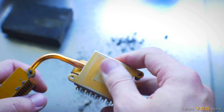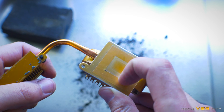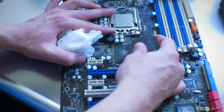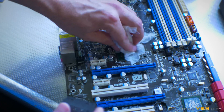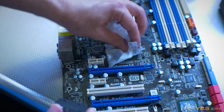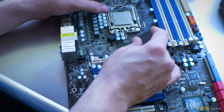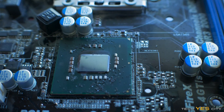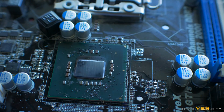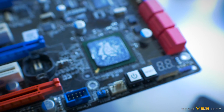That one took a little bit longer than usual, but after you're done you just scrape it back with your fingernail and make sure that it's smooth. Looking much better now — you can see the actual writing still on the heat sink. We've gotten through to the surface and now we're ready to do the south bridge.